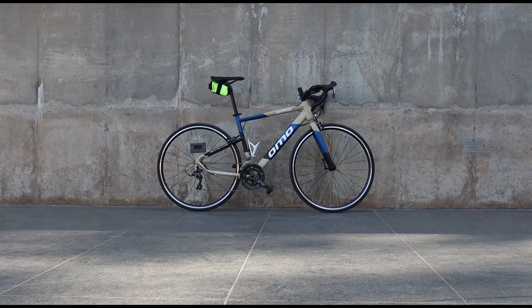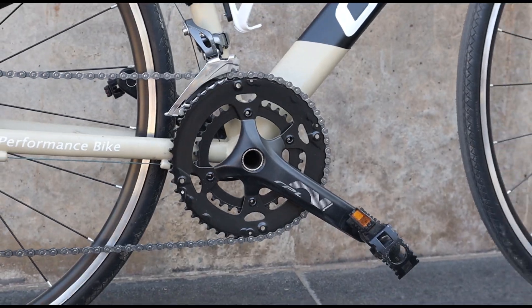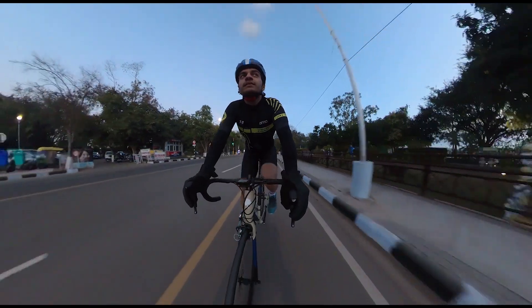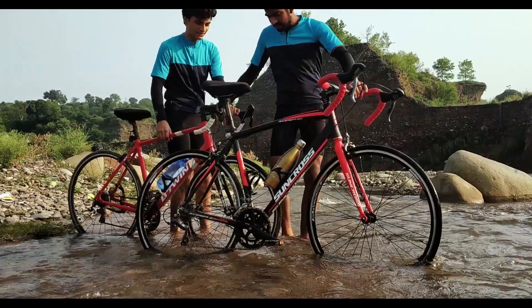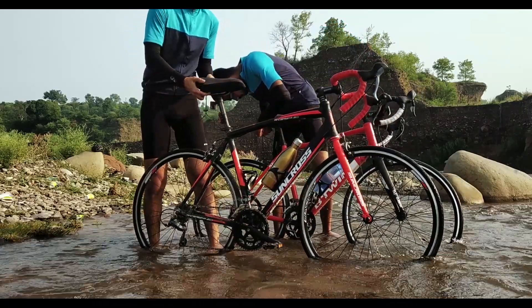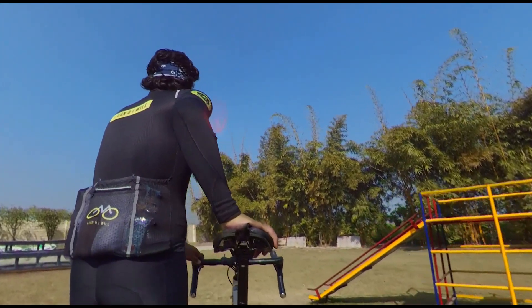One of my favorite features of the bike is the bottom bracket — it is hollow-tec and sealed. You can ride in rain, river, or stream and it will hold up. On my old road bike, I rode through a stream, the water got into the bottom bracket, and it became very difficult to ride home because it had no sealed bearing. The hollow design also reduces the weight of the bike, which is another plus point.